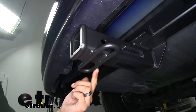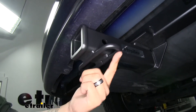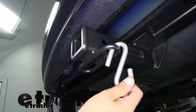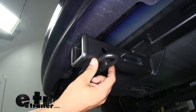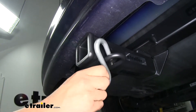If you are going to be towing a trailer, our safety chain connection points are going to be pretty open. It'll be a loop style welded to the bottom of the receiver tube. You can see we have plenty of room to get the hooks on or off. And the fact that the hitch pin hole is slightly offset from the loop means we're going to have less chance of interference with our pin and clip and the safety chains.